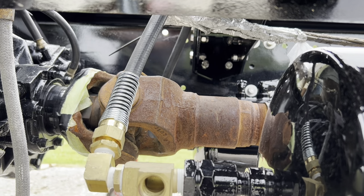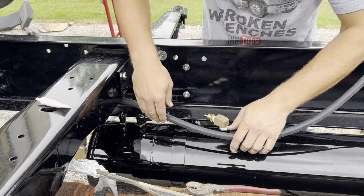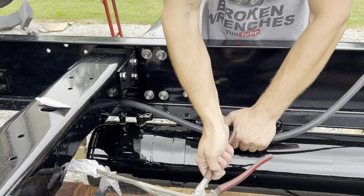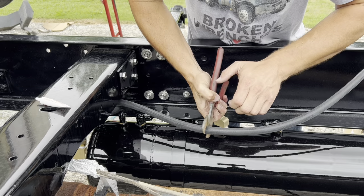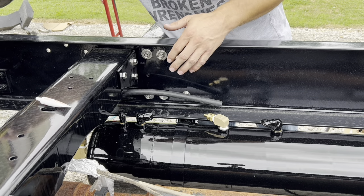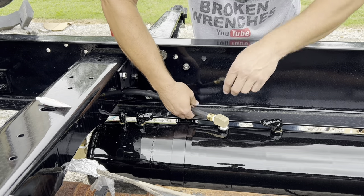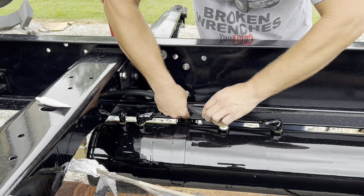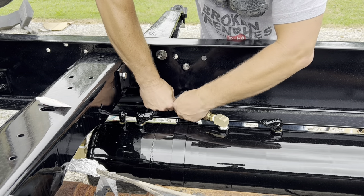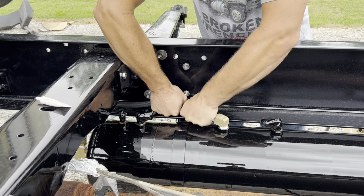This little fella comes from the front of my wet tank. I'm going to put this one into the primary tank — give myself plenty of slack and chop it in here. We're going to put this one into the top of my wet tank. The hard part is keeping this hose from spinning while you're tightening it — twist it as much as I can this way, hold it, and then tighten it. Hopefully keeping it from wadding up like a pretzel.